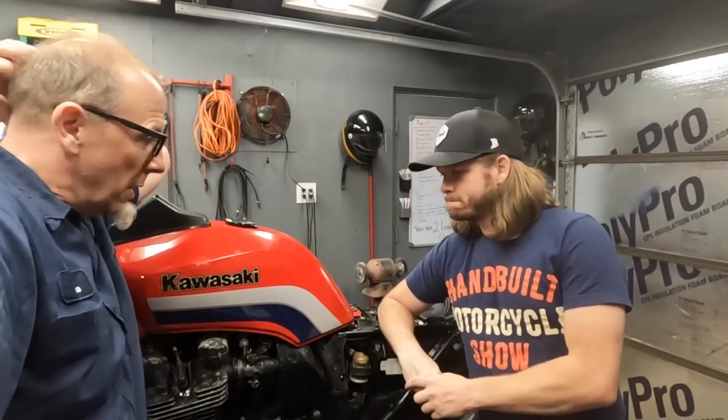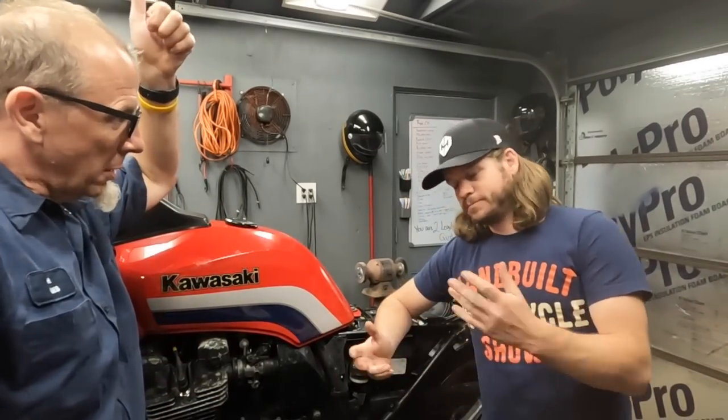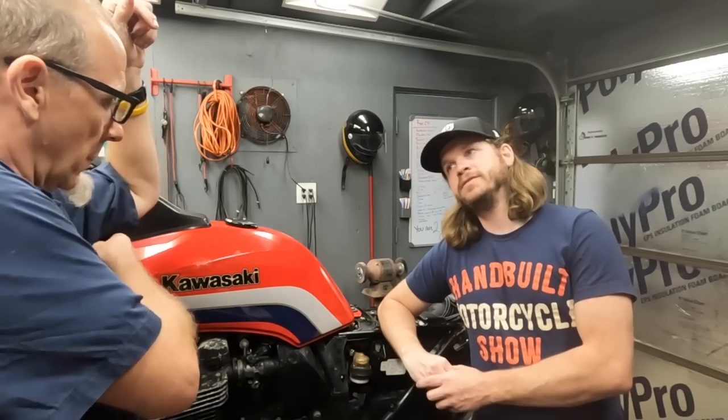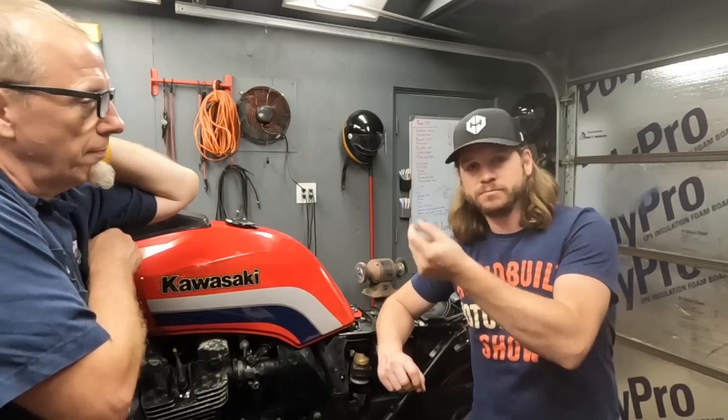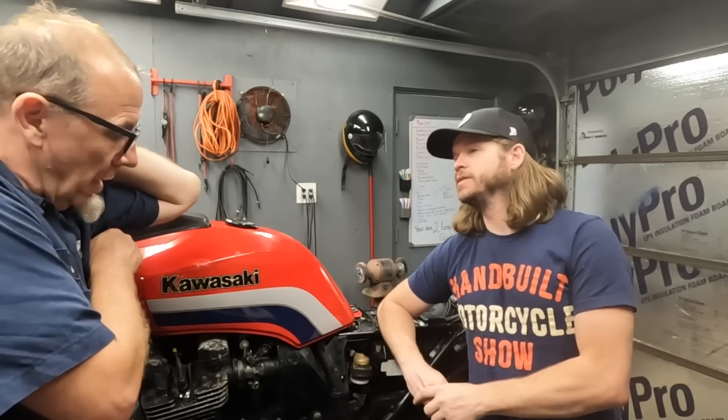So what do we do? New spark plugs. That's probably the biggest difference. New oil. Checked all of the connectors for the DFI. Can't confirm that it was causing an issue, but at least tightening the pins up, making sure there's no play, because they're very loose connections. At least confirming or making that less of a potential failure or issue.